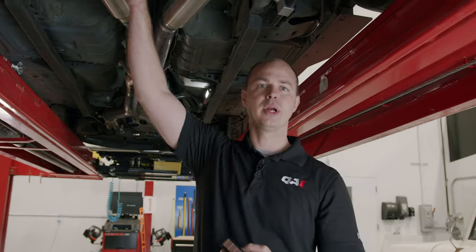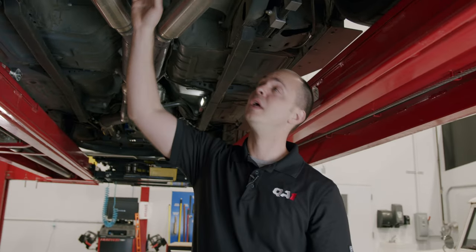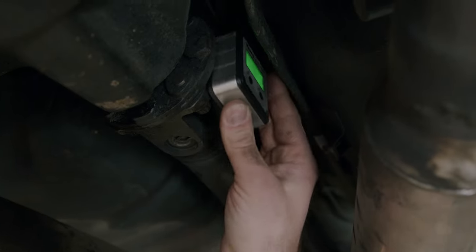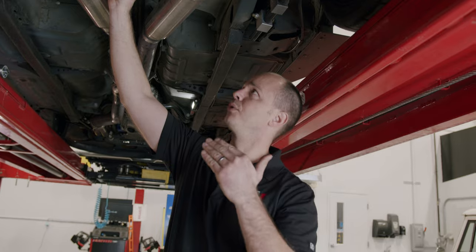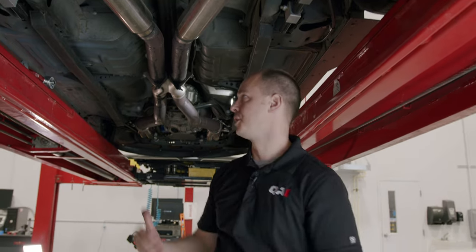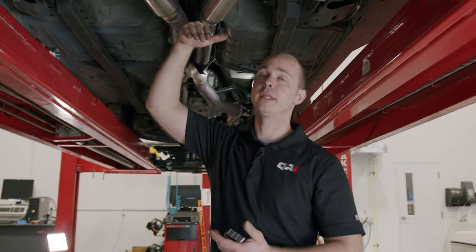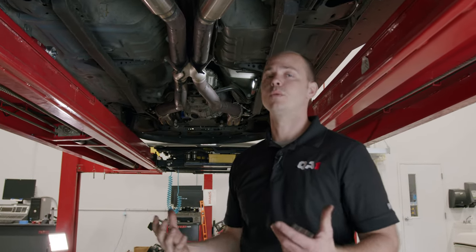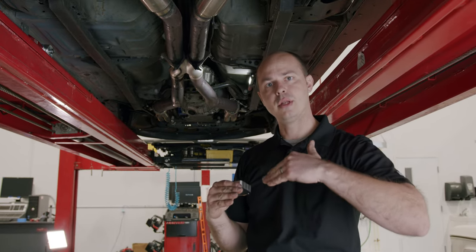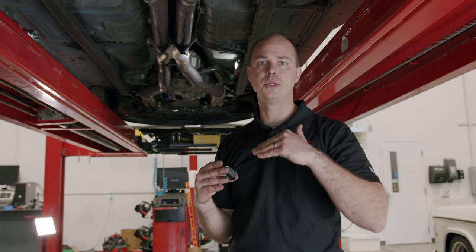On the rear end, we've got an 8.8 in this car, so we've got the nice flat flange on the front of the diff that we can measure off of. We can also measure off the U-joints on the housing. We've actually got about a half a degree or so of pinion up. This car has the factory upper trailing arms in it — they're non-adjustable. Putting in adjustable trailing arms, like the QA1 trailing arms, would allow us to bring that pinion angle down a little bit. Under load, that pinion's going to wrap up, the rear diff is going to wrap up, and it's going to straighten out that angle. So having the pinion pointed down a degree or two is really going to help everything operate more efficiently as the car's under load and going on the track.